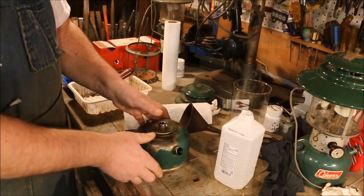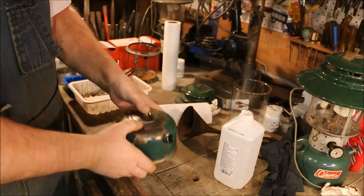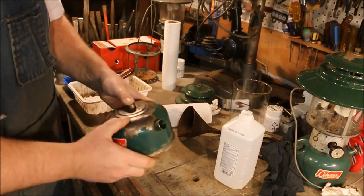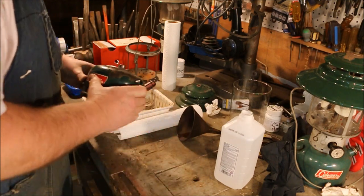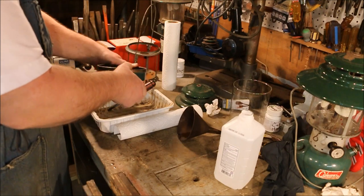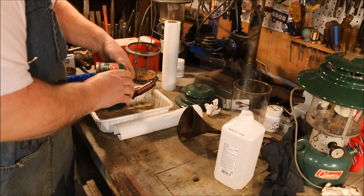Putting the vinegar in there pretty much seals that up. Eats away the rust. Then I put baking soda and water in it to kill the acid in the vinegar. And I rinsed it out with water thoroughly 3 times. Let the water run right through the tank. Give it every opportunity to get any particles out of there.